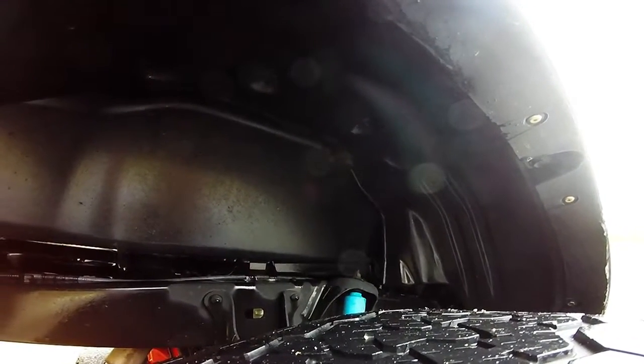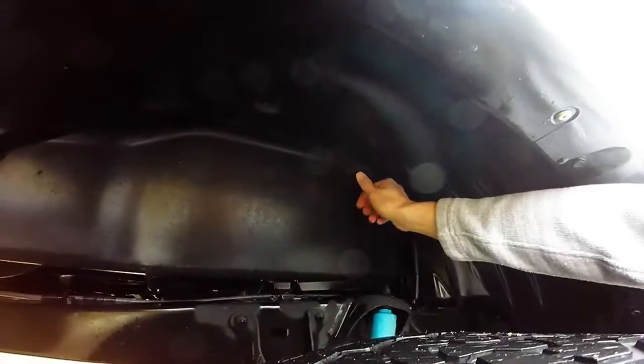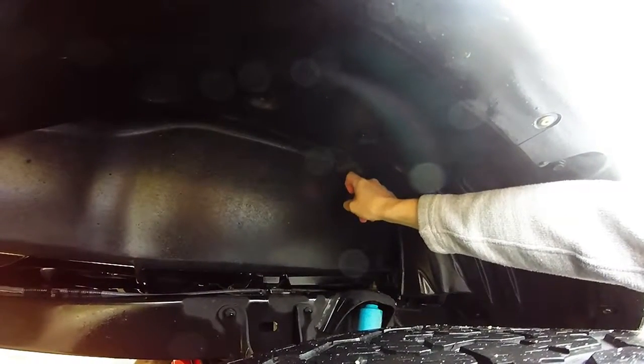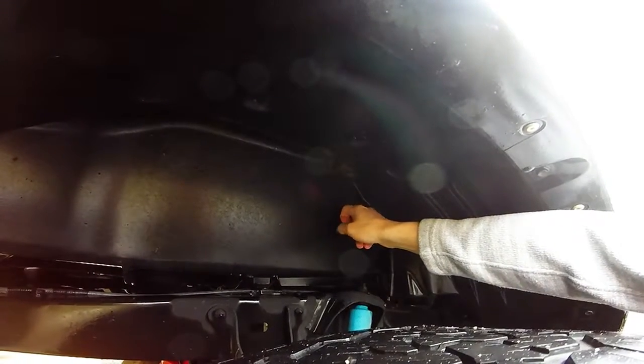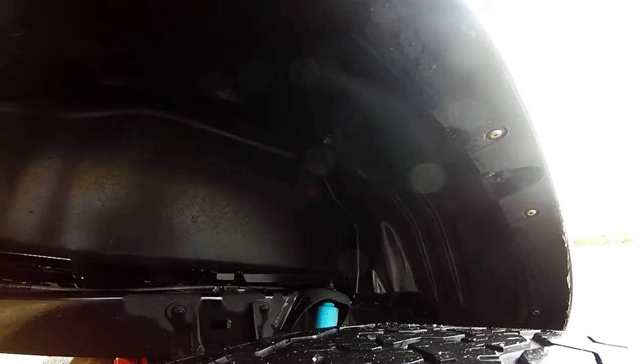What I did is I went to Home Depot and got some one-sided stick foam black weather stripping. It's just a couple bucks — I think it was about a half inch thick. All I did, after cleaning off the side of the bed, was stick this wherever the plastic lining was coming into contact with the bed. I just opened and closed the door a few times to pinpoint it, and used about a foot of this stuff in little sections until the rattle went away.